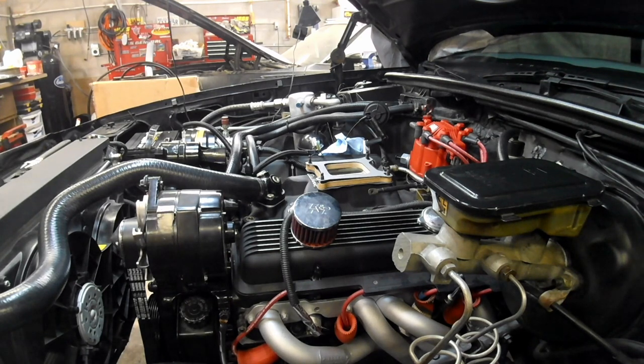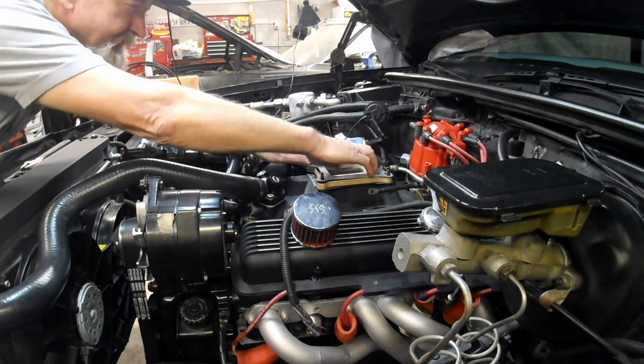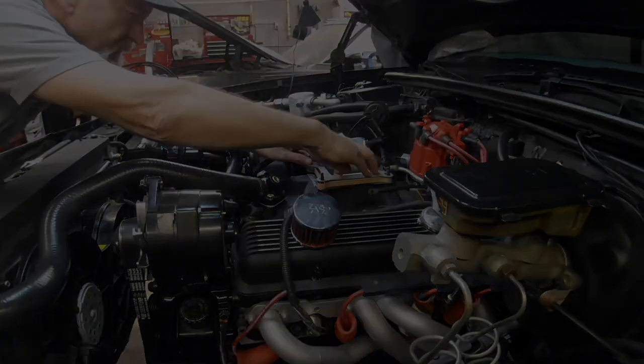Yeah. See, that's why that gasket is like that. You keep that with that carburetor. So we can't use that, can we? We're going to need another. And this goes with that carburetor for the paper. So the way it's set up right now, it should be pretty close to right, because you've got no intrusion anywhere around this spacer.